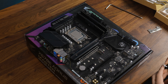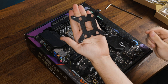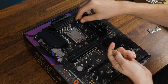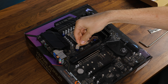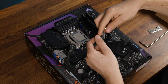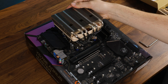To get it going on Intel, take the provided backplate and shove the Intel bolts through — outer position for LGA 1700 and 1851, inner for older sockets — then lock them in place with the spacer clips on the other side. Make sure the bolts come out on the side facing the motherboard. Once the backplate is behind the motherboard, take the appropriate spacer (blue for LGA 1700), put them on, add the retention brackets with the ends pointing away from the chip, and screw everything down. Note: don't use them pointing to the top — there was a post by Noctua a few years back on the original L12S and apparently that's a no-no.